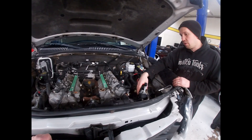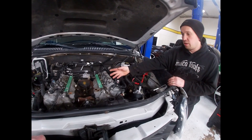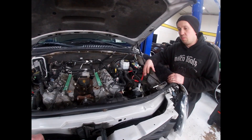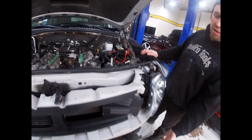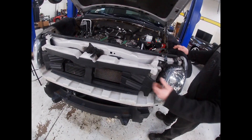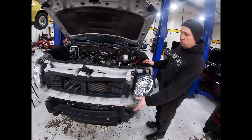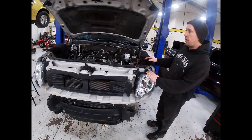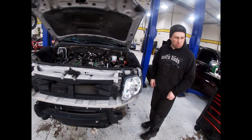Then there's going to be some bracketry on the front of the motor, a couple of different pulleys, and a brace for the tensioner arm. We have to reconfigure the cooling to twin electric fans to eliminate the clutch fan because the alternator gets spun around backwards and will be sticking toward the front of the truck. We took the front bumper cover off to get access and mount the heat exchanger for the water-to-air intercooler setup that comes included in the kit. We also have to mount the water pump and wire that up.